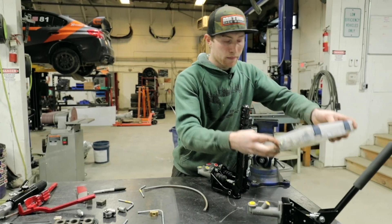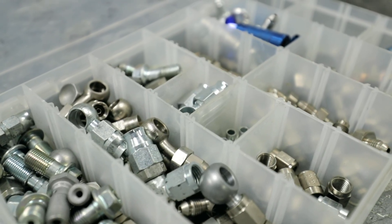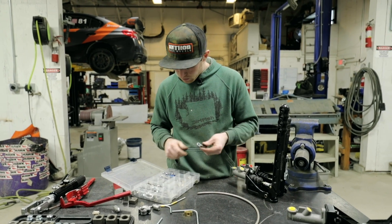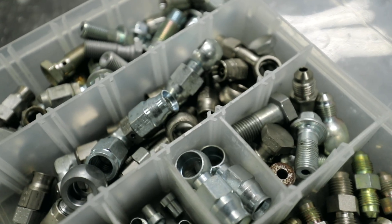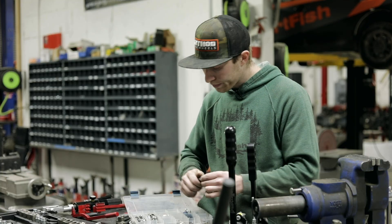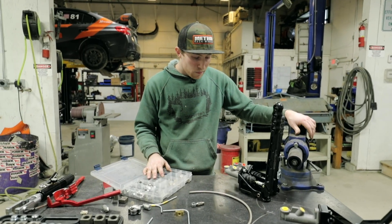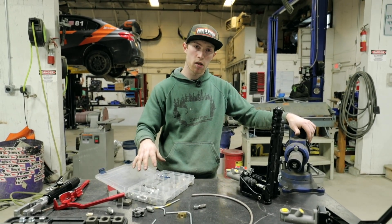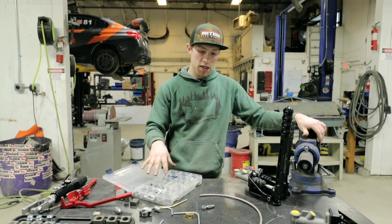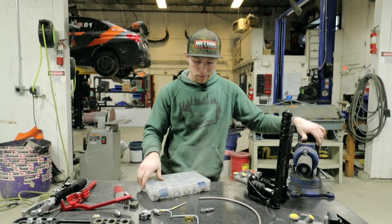To make an AN line, it's a little more complex and there are all kinds of fittings. We could do an AN straight here and then adapt a banjo to it, screw a banjo in. Or they make banjos that have a seal and olive fittings that basically go onto this hose, crimp on, and tighten up. It's very important to know what flare and what fittings you need on the handbrake, on the master cylinder, on your brake calipers. You need to map everything out before you start building and ordering parts — that way you know the thread pitch of everything, the flare pitch, and you're not ordering incorrect parts.